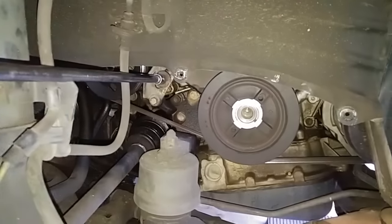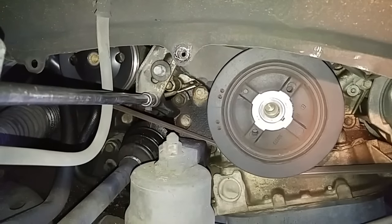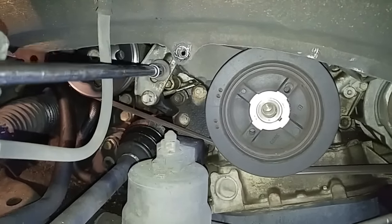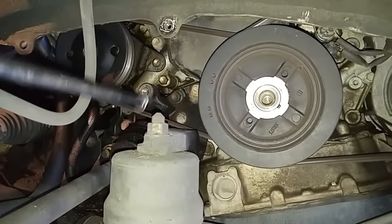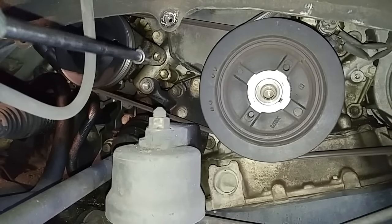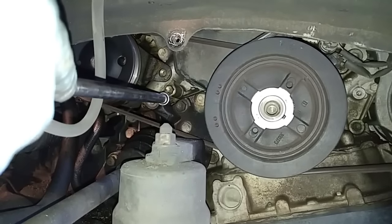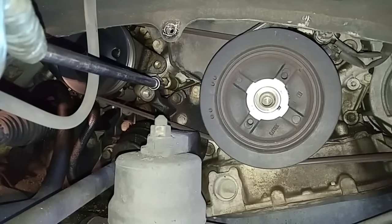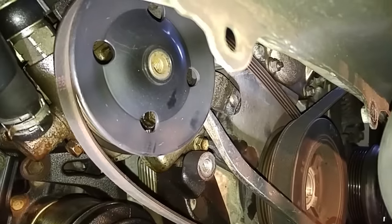This is the adjustment bolt, and that's the bracket bolt. The timing belt tensioner is right here. This adjustment lever for the power steering pump — you have to move this back and forth in order to get access to the two 12mm bolts that keep the tensioner on the engine block. Now I'm relieving the tension on the power steering belt.